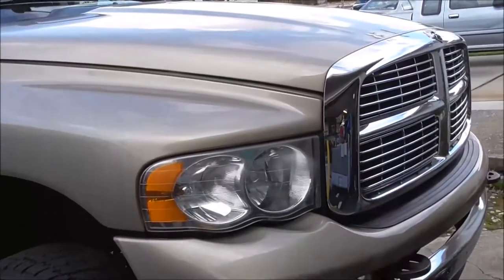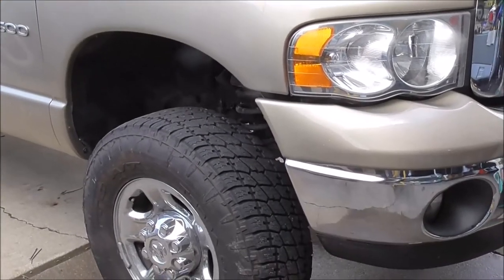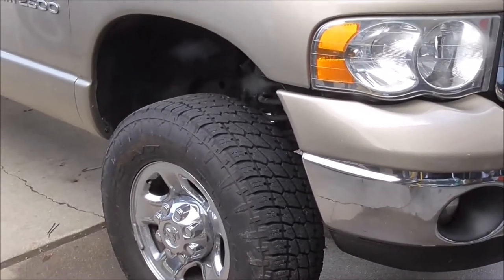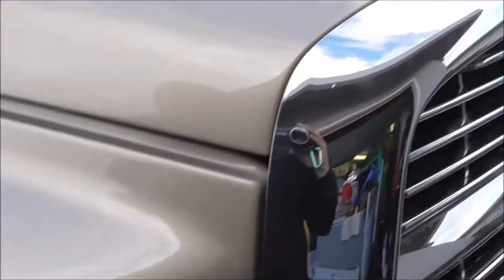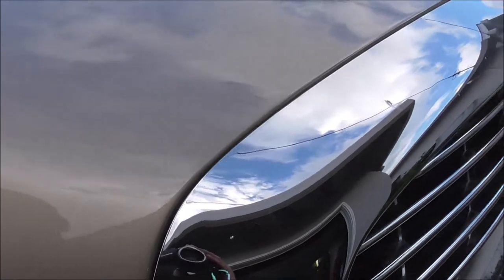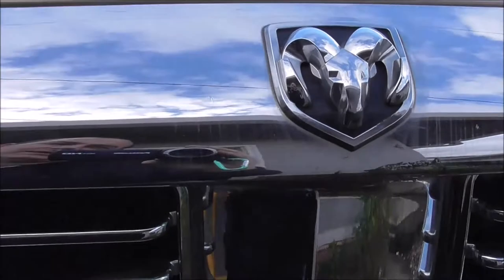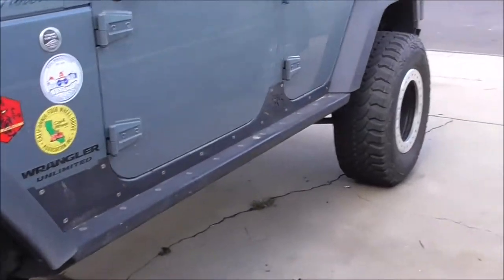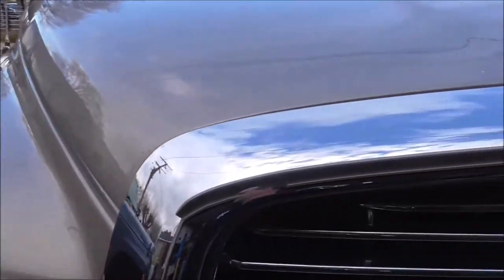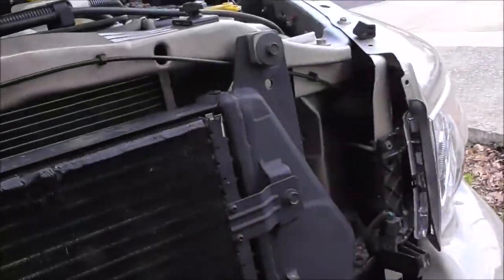Back on the RAM. I have an electrical issue — I don't have a left turn signal or brake light on the trailer wiring. It's common on these trucks. They're made for pulling, so they don't have a wiring harness tapped into the taillights. It has its own wiring that goes all the way to the fuse box.